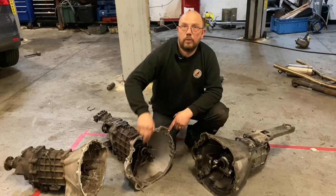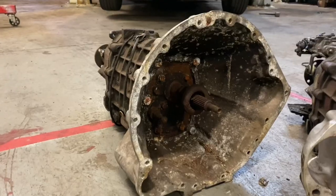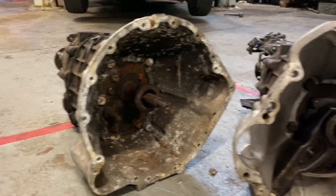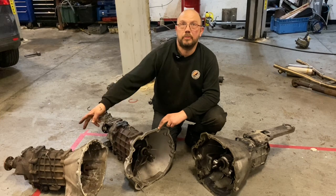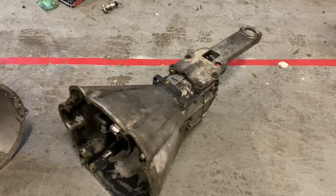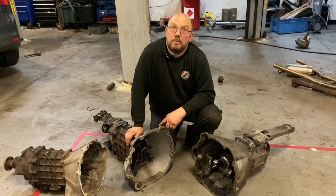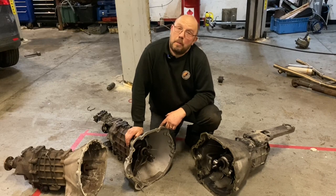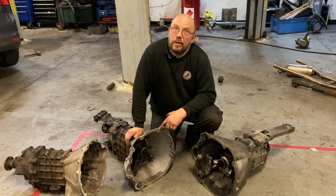If you get a box from a V8 it will already have the correct bell housing. If you get one from a straight 6 - 2.6, 2600, 2.3 SD1 - or a TR7 5-speed, it'll have the wrong bell housing, but bell housings are interchangeable so you're going to buy a V8 bell housing, whether you buy a used one or a reproduction from Rimmers. A lot of people ask about the TR7 box - internally it's basically the same as the rest, and given it's a smaller lighter car with the least powerful engine in the range, chances are the TR7 box has actually got less wear than any box out of an SD1.